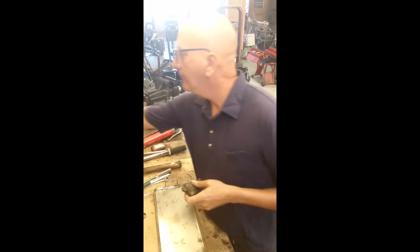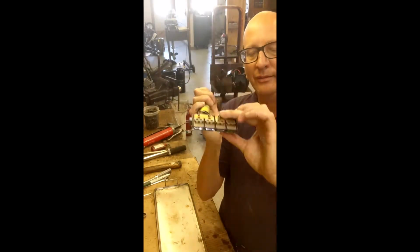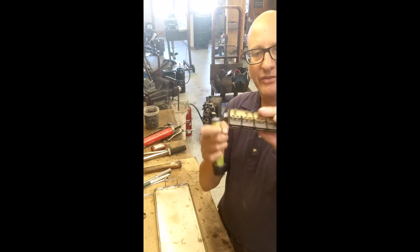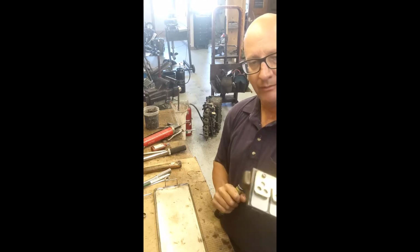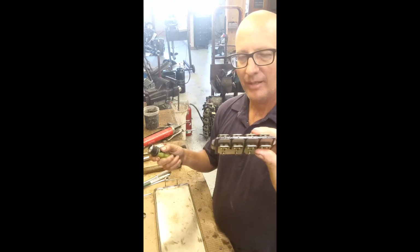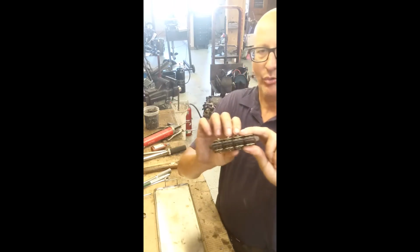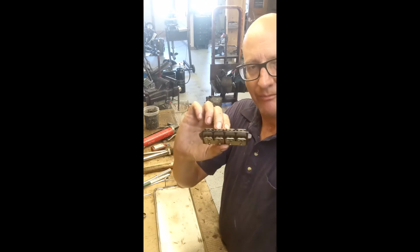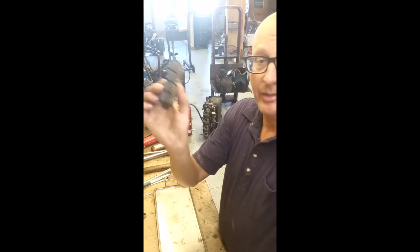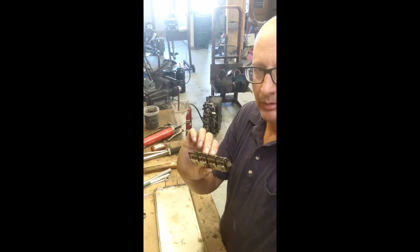But you get gaps in them. If we can see it, I'll try here. The light coming through, there's not supposed to be any light coming through. I mean, it's old, so the reeds seldom, if ever, break. 1 out of 1,000 repairs, maybe 1 out of 500. It's got a busted reed, and usually the fuel spits back at you, so you know right away. So we're going to take this all apart and show you how to reset them, tweak them a little bit. They don't need to be replaced. They really don't wear out.